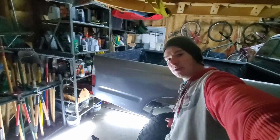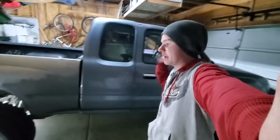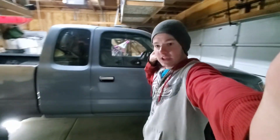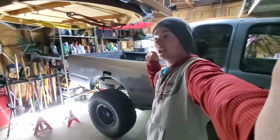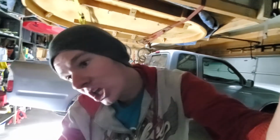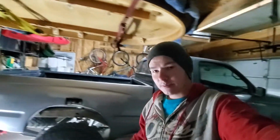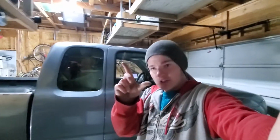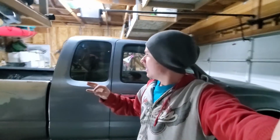So today we are going to be working on my emergency parking brake. It hasn't worked. I've owned Katie for 2 years. Hasn't worked once. So I took it to Keith's dealership. We put it on the lift, and I took it all apart and figured out that the main part, the bell crank actuator is what they're calling it, but the little lever is seized, so it doesn't pivot anymore. So we're gonna go ahead and put those in there and then adjust it, and it should align it.